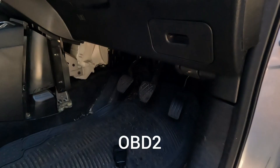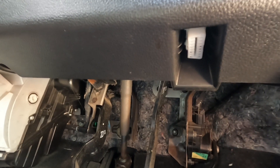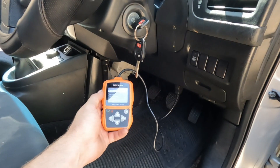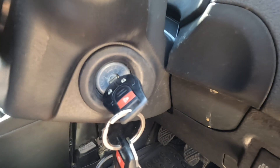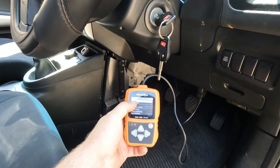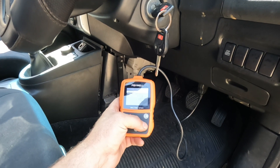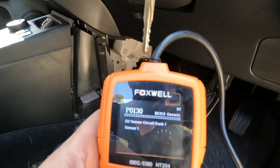If you're looking for the OBD port, it's straight underneath the dash — it's that white plug. I'll plug the OBD reader into it and turn the car to on. With the OBD reader plugged in and the key in the on position, we'll just go into read codes, stored codes. And there we go.